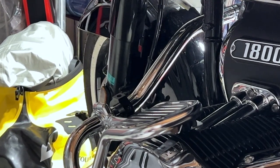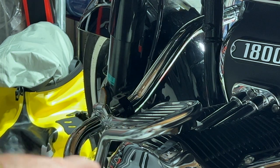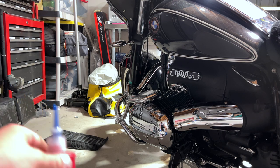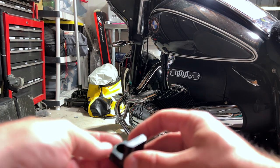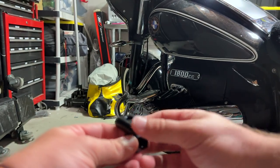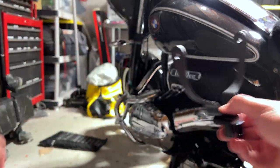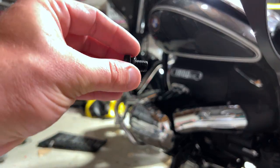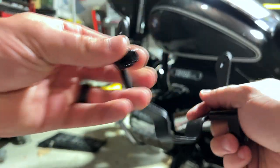Over there I've got the one-and-a-quarter-inch engine bar already mounted, with the hole in the top turning forward toward the front of the bike. You should probably use some Loctite — I use the 243, though 242 is fine as well. Since this is going on the bike like that, on top we can go ahead and hook it up just like that, using the 17mm hex with that collapsible washer that has some resistance to it.